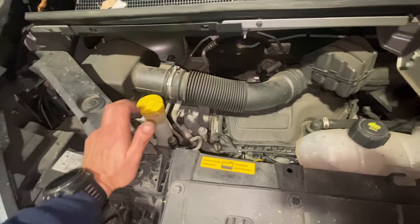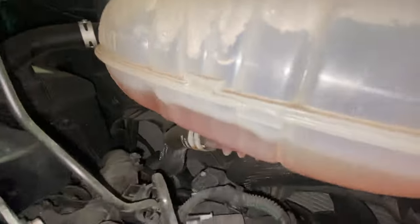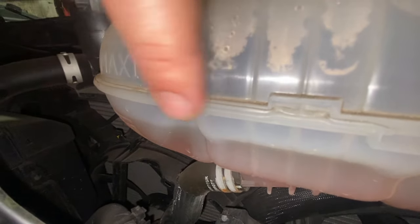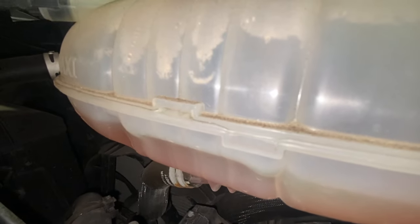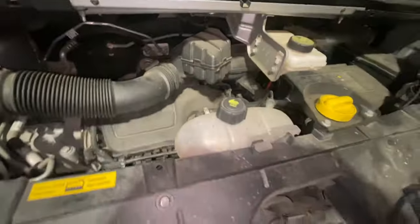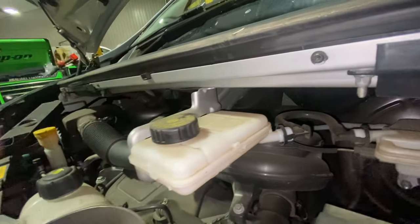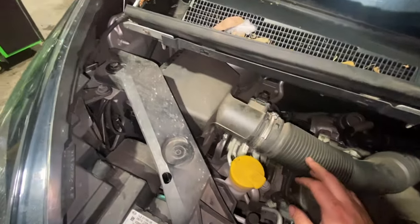Just before going on to the filters, I'll run you through some of the basic bits under the bonnet. There's the screen washer cap to fill up the washer fluid. There's your coolant level — I did just notice this one is slightly low. Checking the other side, it's got a little marker and the max line is on this ridge, which is a little bit low, so I'm just going to top that up. Just have a quick look around to make sure there are no leaks. The brake fluid reservoir has just got a max point on it as well, so you should be checking that level. Your air filter is located in this housing, and all we need to do to get that off — we've just got some little torx screws, one on each side.